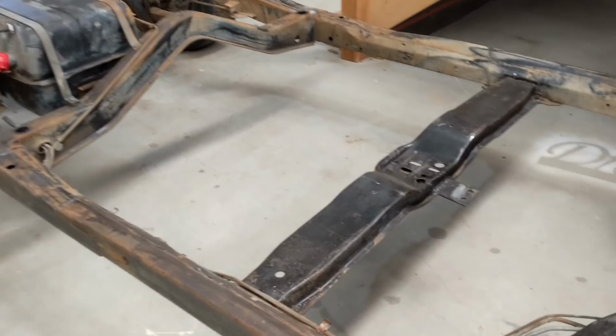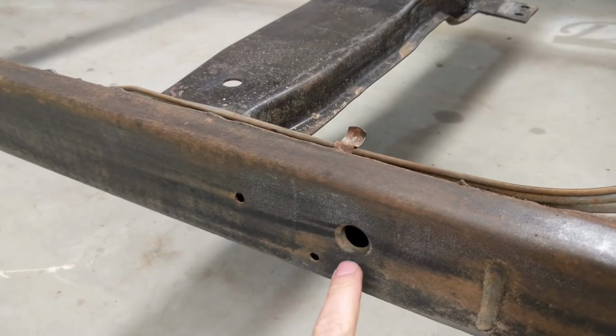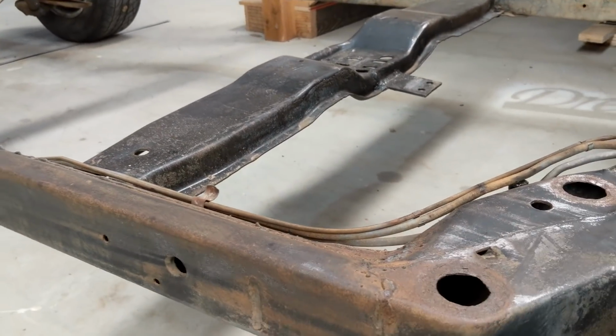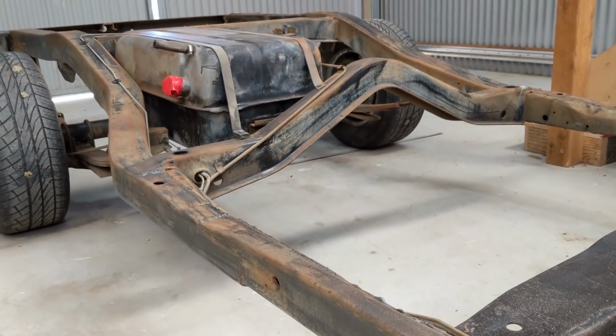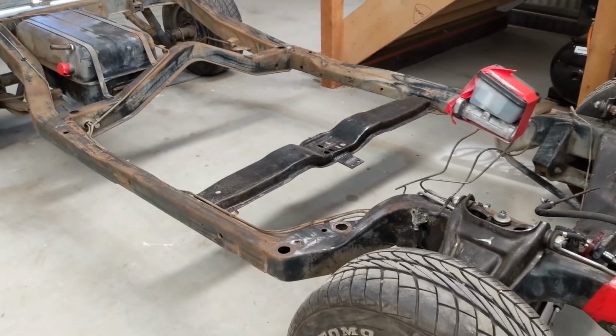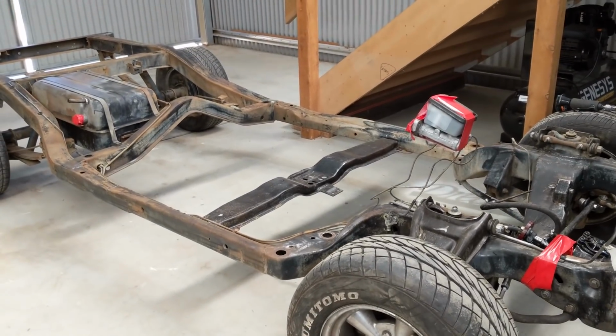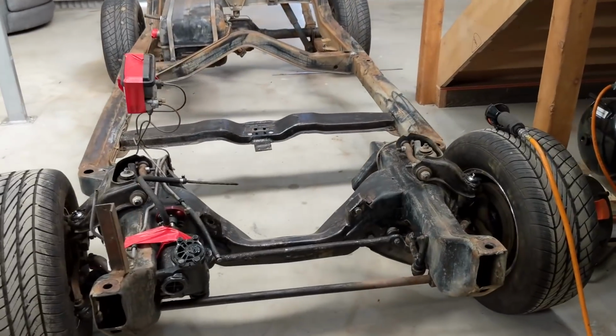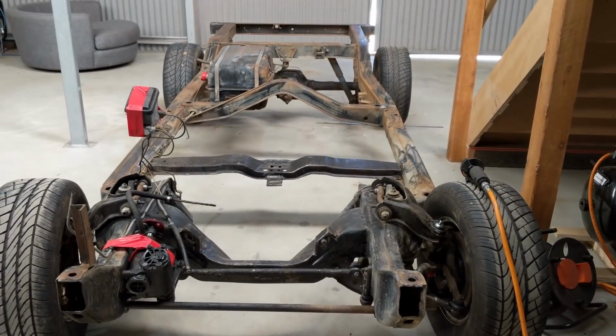And also I spoke to a few guys about getting inside here, obviously, because I'm not going to hot dip this chassis. It's too expensive and I can't be bothered going through all that effort. You can get sprinkler fittings that you put around your garden in a drip system, and you can get a little atomizer 360 tip, and then you can connect that to your hose and then feed it down the length of the rails and spray it.